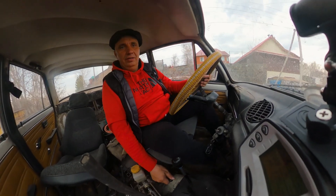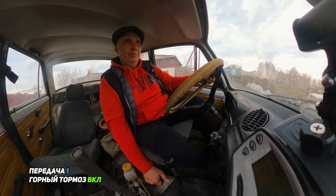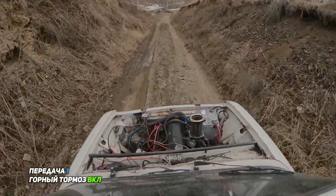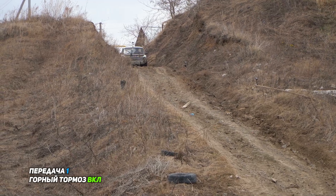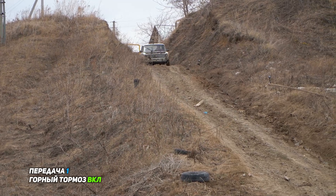Let me go back up. Feet off the pedals — 15 kilometers an hour and here we go. I have blocked off the exhaust system. We've come to a dead stop right on the hill, and we only traveled about 30 meters. Let's attempt to roll and try this again on the steepest spot of this hill using the retarder.